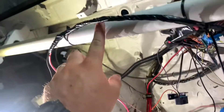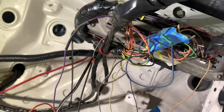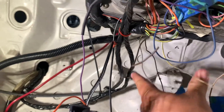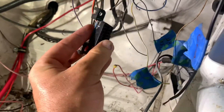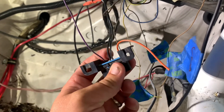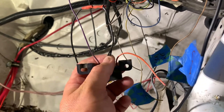This is the constant 12-volt source for the O2 sensors. I have it two-to-one inside of here, ran up underneath here. These are my two O2 sensor harnesses that go down and around. This is the OBD2 — pretty simple wire-up. These two black wires — solid black and black with white stripe — those are your grounds.